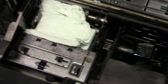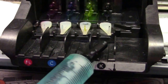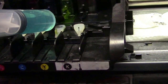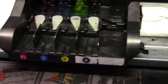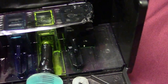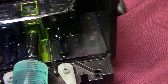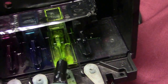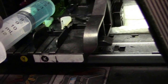Now I'm going to insert the tip with some cleaner into the printhead. You can clean them all or just the one that's giving you the problem, like not printing or clogged. Slide it right over that little tip that sticks out — push it in all the way and carefully and gently add some of the cleaner. Then wait a minute, pull back, then push in. I slid it right in — now I'm going to push.